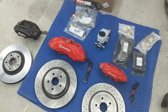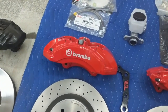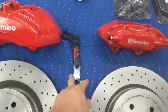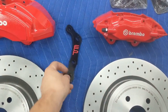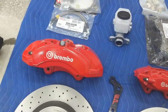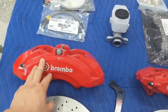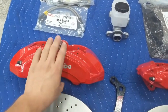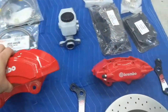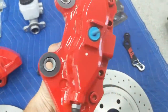This is a kit that was ordered through Peter Kopp on the Supra forums — he's also on the Facebook pages. He developed these adapters and had them stress tested, both front and rear, that allow you to use SRT8 calipers on the Supra. These are OEM quality calipers — they're authentic Brembos. The fronts are six-piston and the rears are four-piston, off the SRT8.